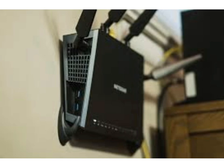6. Attach the modem to a router. If you have a Wi-Fi router that you want to use in conjunction with your modem, plug one end of an Ethernet cable into the square port on the back of the modem, then plug the other end into the Internet, or similarly labeled, square port on the back of the router.